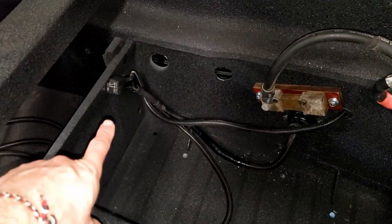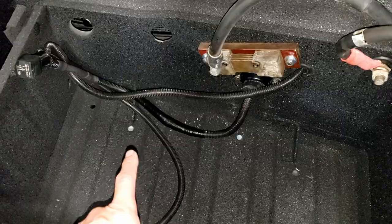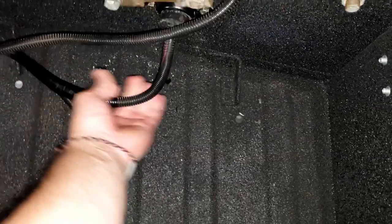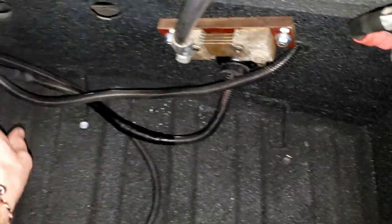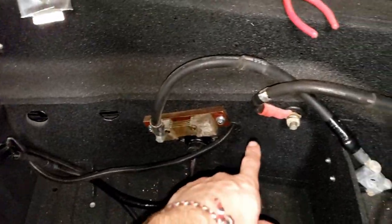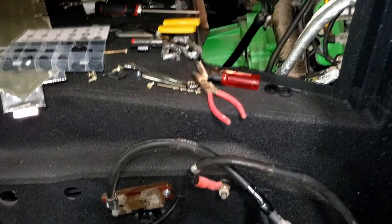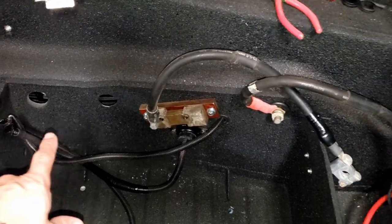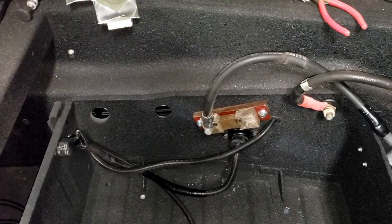All right, so I got a little bit more done. I worked on our lift pump harness here. I modified that up a little bit because basically where our lift pump is like right there, so our plug wire really didn't need to go that far. That's ran connected in place. This is basically our trigger wire for our relay. And then we have our power wires here, waiting for our batteries to go in. Our trigger wire runs up, the small little cable there runs through the wall. That'll run up into our ignition system. So whenever the ignition is on, it'll kick in that relay and allow the pump to run, and then you'll turn it over once you let that pump prime just a little bit.